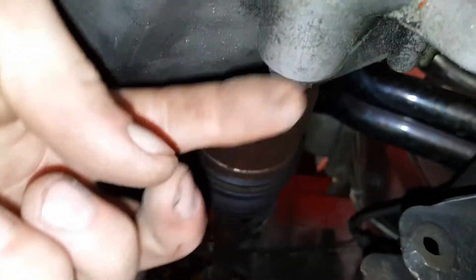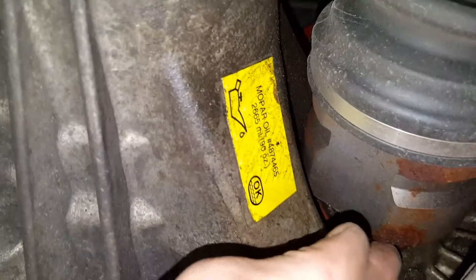10mm. There's a drain plug under here — we're going to drain the fluid. Right here is the drain plug. We're going to crack that open and drain it. Then we're going to pop the axles out on each side. We'll put a screwdriver here and pop that out. Once we get there, we'll be back.